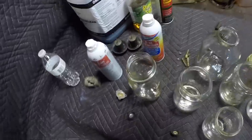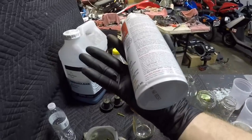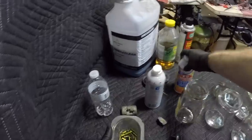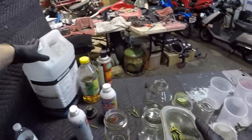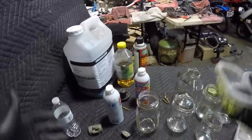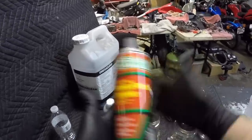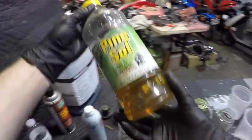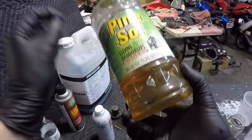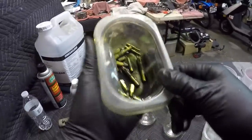I'm gonna be soaking many parts that need cleaning in all these chemicals. I know these say one ounce per gallon — I'll be using them straight. The Omega Sonic cleaner uses actual heat and vibration to help clean, so there are pros and cons to the way I'm doing it, but I don't care. This is brake contact cleaner — it's not supposed to be used for soaking carb parts but I use it to clean carbs. I'll also use a household product like pine sol with a little baking soda mixed in.